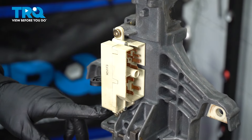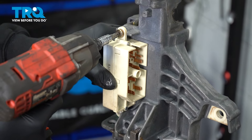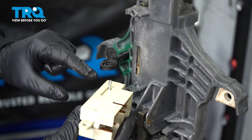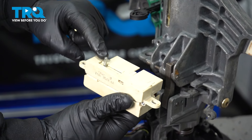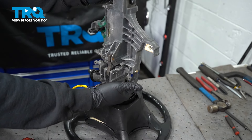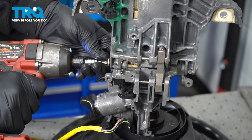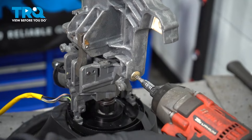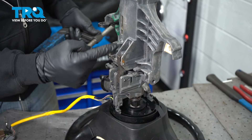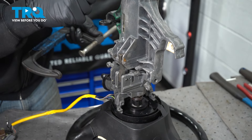Let's go ahead and remove the two screws holding this ignition block here. Remove this and pay attention to the position of the post or pin and where it's located. On each side we have a T30 screw or bolt — I'm going to go ahead and loosen and remove those. Now right here is a large heavy-duty spring inside — it goes to this pivot rod and latches over here. We need to compress this spring, which is going to unlatch from here, and we'll be able to slip this whole unit up and off.